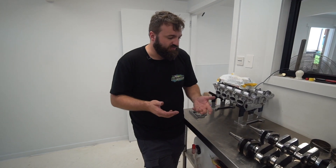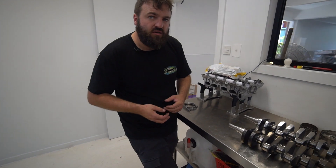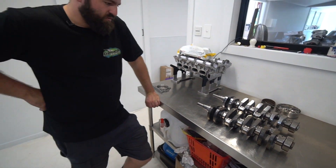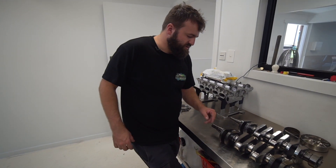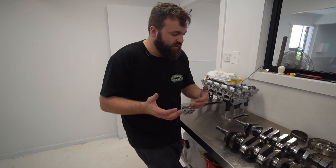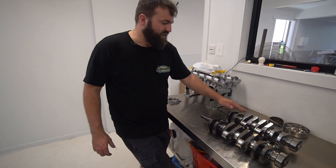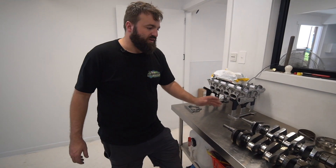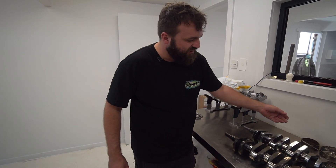So you get crack resistance and oil stability and temperature benefits. Does it have any benefits to the other finishes of the crank, like as far as oil passing past it? Yeah, so windage is a thing. As a crankshaft is spinning inside the crankcase, there's a lot of windage going on. A smoother surface is going to pass through the wind better. I haven't specifically tested for windage — if I was really concerned about it, I'd be knife-edging the crankshaft to try and get it to cut through the wind a bit better.